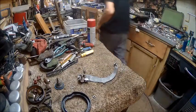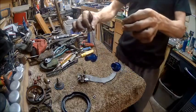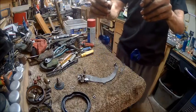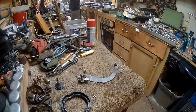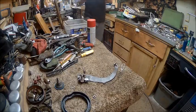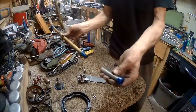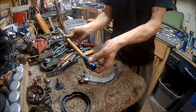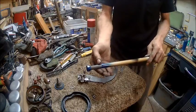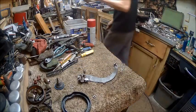So we'll paint that red and this will get painted blue. The reason for that is I have already painted the adjusters — the slack adjusters. I want to do one more coat on these, and I just wire wheeled them on the grinder. To paint the end caps I found a piece of pipe that those would slide into so that we didn't get anything on the threads, because they're going to have anti-seize on the threads. That will help protect the threads too. I just stuck them in the pipe and painted it. As long as I keep it level I'm okay.